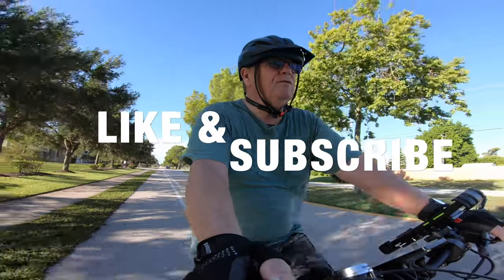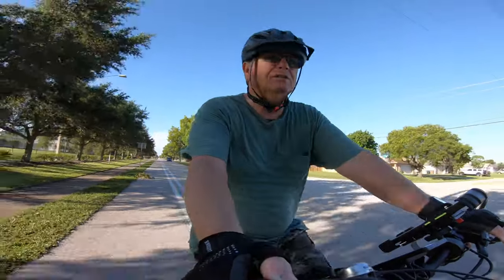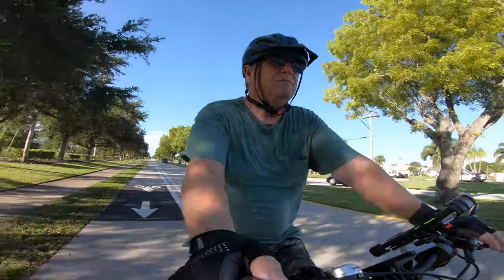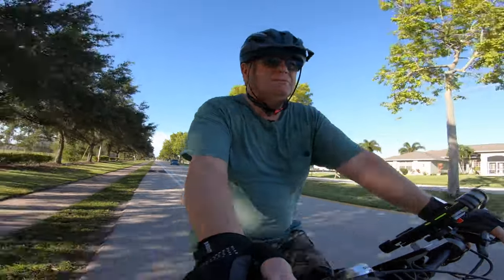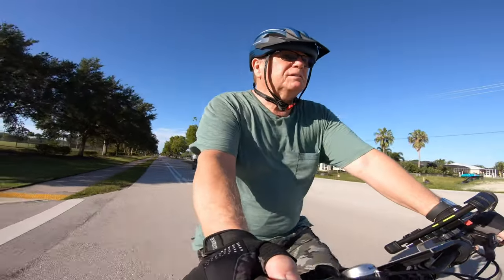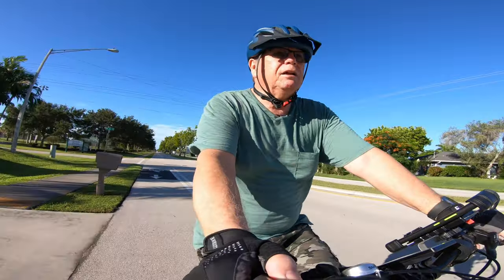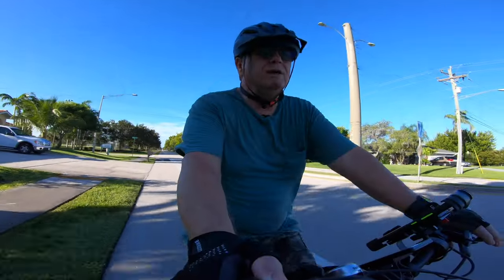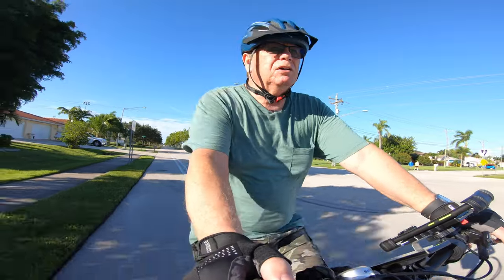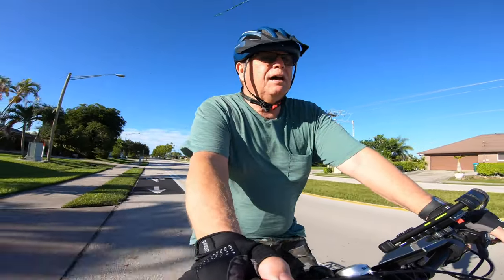Ran into a few fitment issues with the brake. I had to get a 1 millimeter spacer and space the rotor out 1 millimeter. That wasn't a big deal. A little bit of research on YouTube showed me there was a spacer available. Somebody else had it when they put in their mechanical hydraulic hybrid brake calipers. So it looked good for me, so I ordered one. Space that rotor out 1 millimeter.